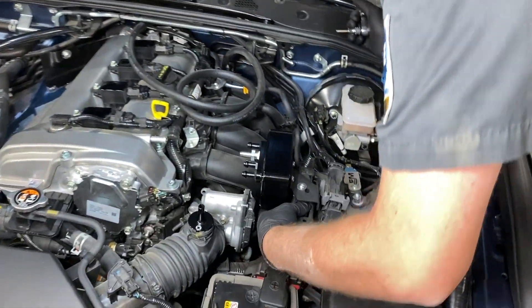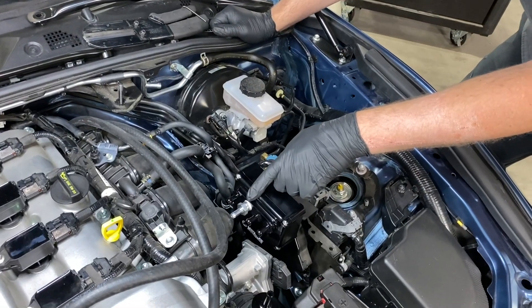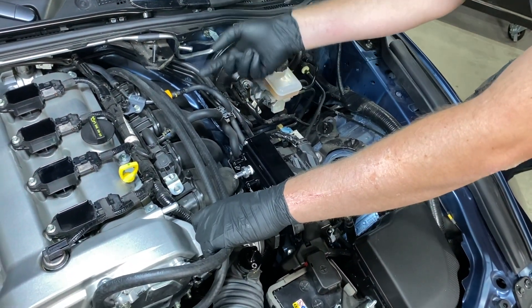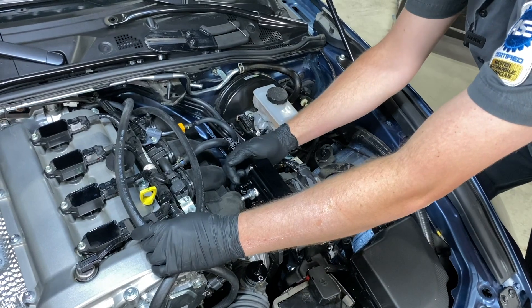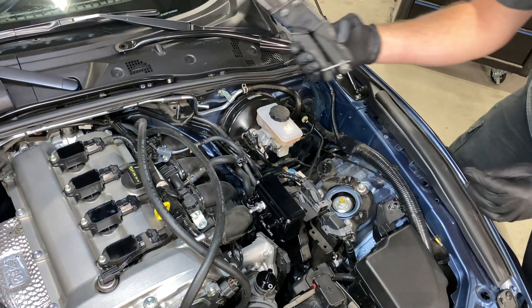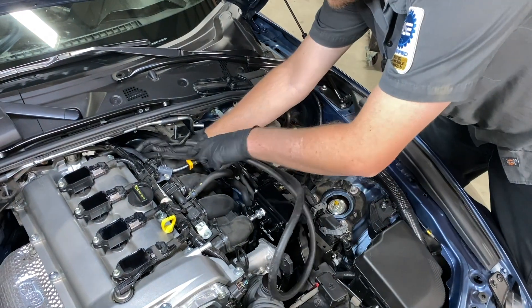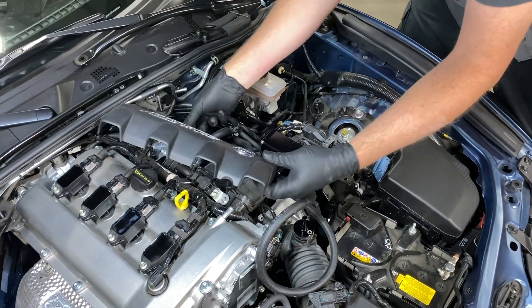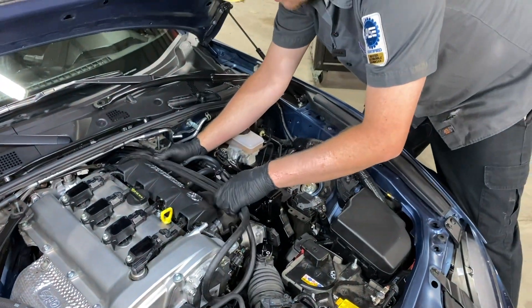Now we can go ahead and hook up our lines. There are two lines where it's very important you get the order correct. Not all of our fittings are the same — one of them has a check valve in it. The one with the check valve needs to go to the hose that goes to the intake manifold. The other hose that goes to the PCV valve goes to the one directly behind it. Use your snips to cut them to length as necessary. You may also experiment with how you want your routing — typical is right over the top here. Maybe even plug in your cover so you know you're not hitting it, and make sure you're not pulled tight either.